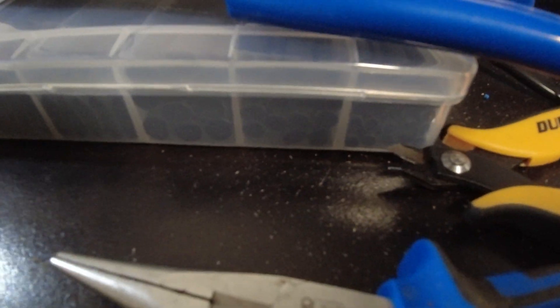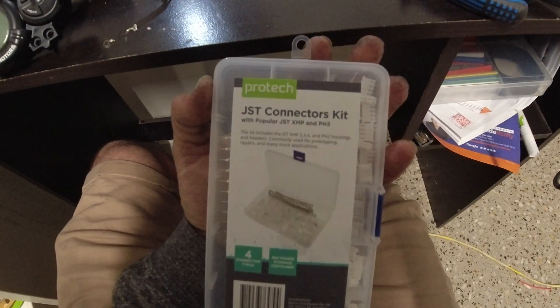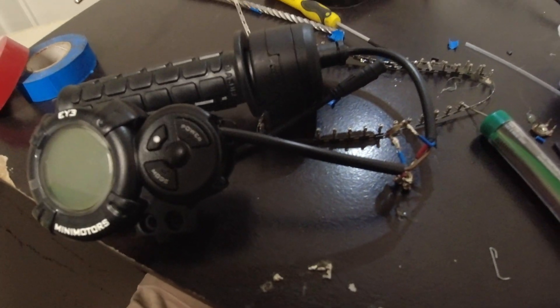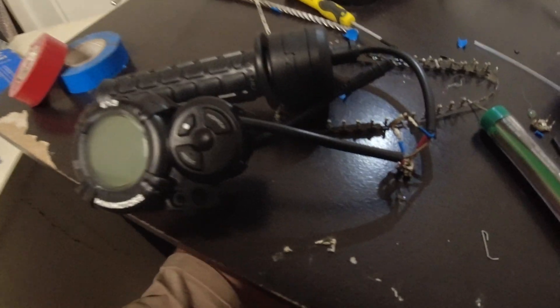I might just put heat shrinks on it — you should find out in this video anyway. These clips out of the JST connector box, buddy clipped on — mint. And then I put some solder over it after because it stuck to the clips way better than it was sticking to those pins. She's held on prime. I'm going to put it on the scooter and probably do a few test rides either tonight or in the morning.